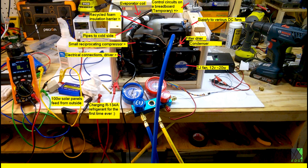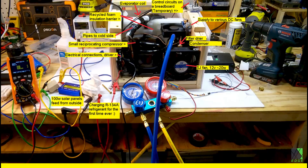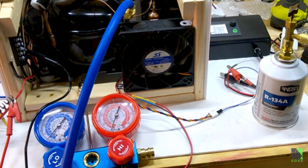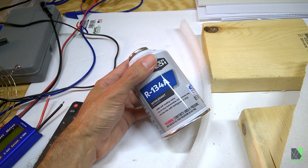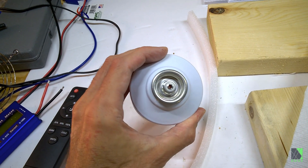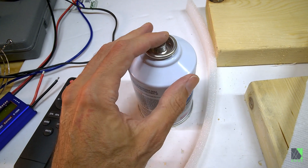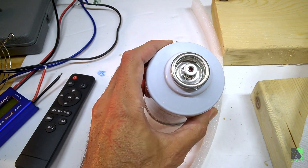Every common window air conditioner has foam insulation between the inside and outside compartments. I'm pushing myself to learn more about refrigeration, so I bought some gauges. I connected them to the air conditioner using a blue hose, attached a refrigerant bottle, and carefully allowed some R134a to flow in. I've been practicing with this type of work. The refrigerant I'm using is R134a — very common, not exotic. It comes in a self-sealing can so you can disconnect and reuse it later.